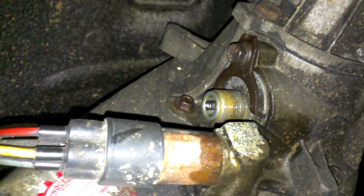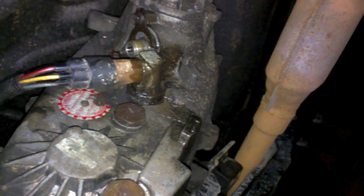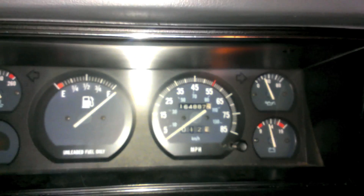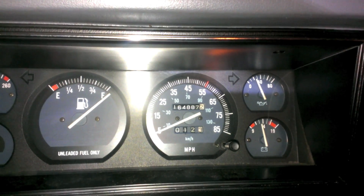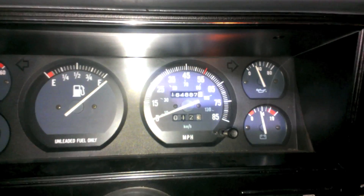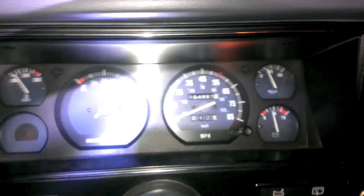Hopefully if you're having any issues, that helps you out. I pulled this thing out and made sure it locks into the gear — and that fixed my issue. If I let off the brake, she climbs. Beautiful. So if you're having issues, make sure your cable is properly meshing with the gear — pull it out, spin it, make sure it's free, then pop it in.